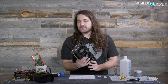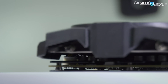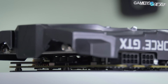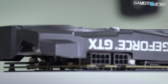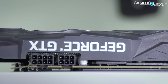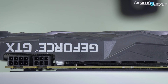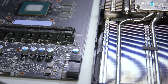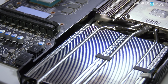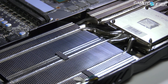A couple of things about this video card. This one might be appealing because it's a three-fan cooler and it's reasonably priced. The cooler, however, is running a two-slot form factor configuration. A lot of the larger fan coolers on the market lately have been two-and-a-half or even slightly more for the expansion slot size, and that means that although it will fit in more builds more easily, it is using a much thinner radiator or heat sink — in fact significantly thinner, about half the thickness of what we saw on the recent 2.5-slot design.